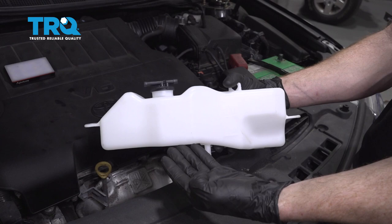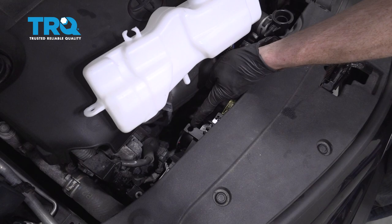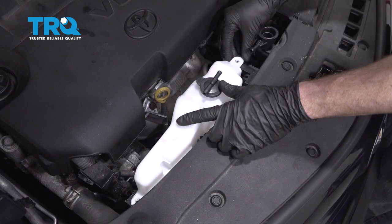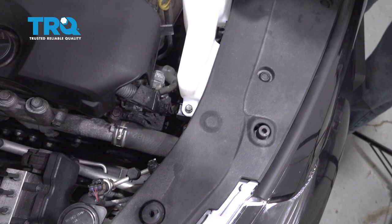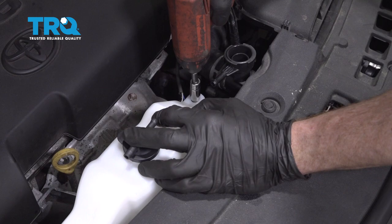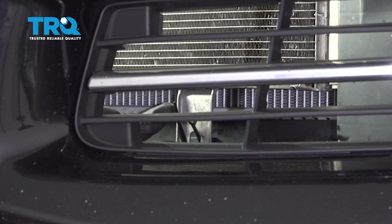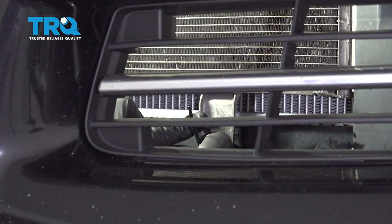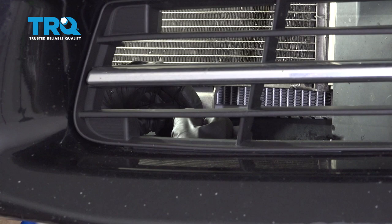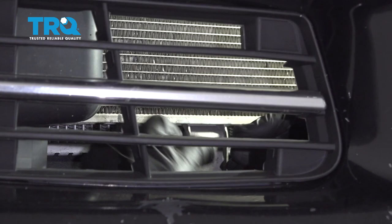Before you go ahead and put on your coolant reservoir, it's a good idea to dump out any coolant that was in it and replace it with some brand new coolant after we get it installed. Bring it right down — we have this little nub right here that needs to line up with its corresponding hole. Line up both of your bolt holes, start them in and then snug them up. Now let's get back underneath the front of the vehicle and start tying in this lower aspect. Ours was mounted with wire ties, so that's just what I'm going to use. Do the same to the other side.